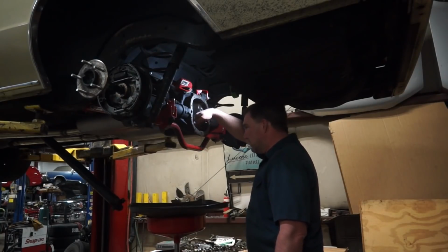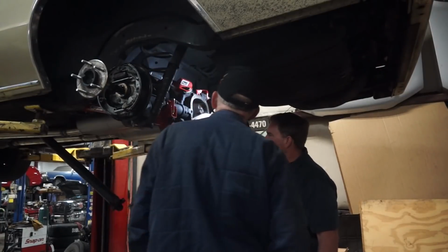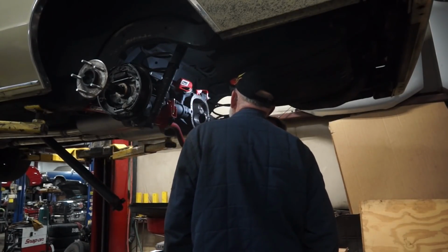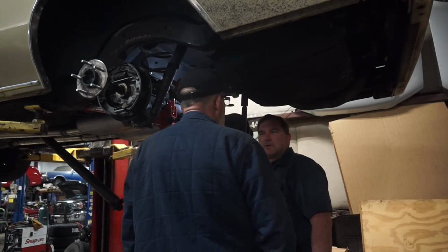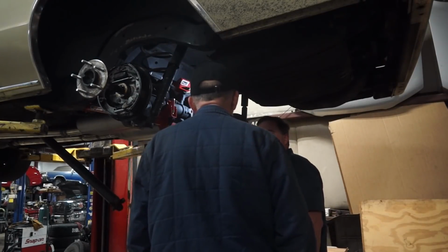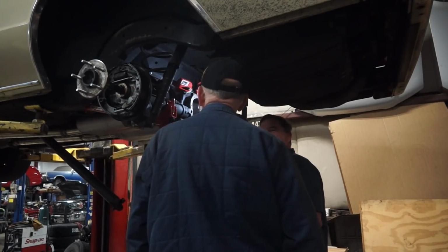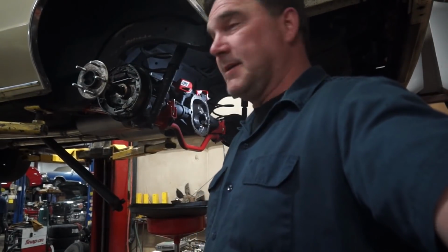There's no teeth in this one. You can see it's got a little bit of glitter in it. That's from where it was wearing. But its drive side is sharpened, so it sharpened it like a knife. And I think that the 150 horse nitrous hit exceeded the lubricity of the gear oil. So I'm going to clean this thing out, put it back together, and then we'll move forward. I'm going to fast forward a little bit through this process because I got work to get done.